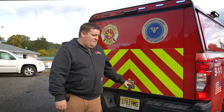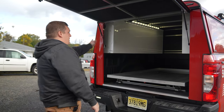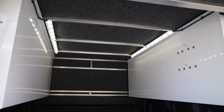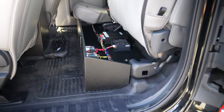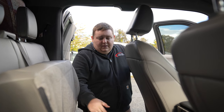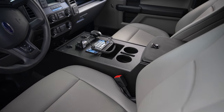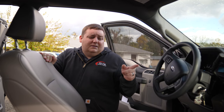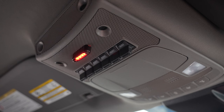They all do the white override scene function. With our hatch lifted up, you can see the Sound Off compartment lights tied into the Blueprint with the help of a pin switch. We've got a SlideMaster slide-out tray with the IMS pull-out lock. This truck is the extended cab model, so we have the suicide door. We have the underseat electronics compartments with our Blueprint controller and Aftershock siren system. The center console has our USB outlets, radio, siren, and light controller. We also tied our upfitter switches into our Blueprint control system for additional programmability, and integrated a compartment open door indicator for all the cap doors.